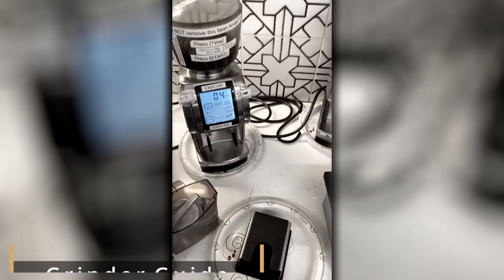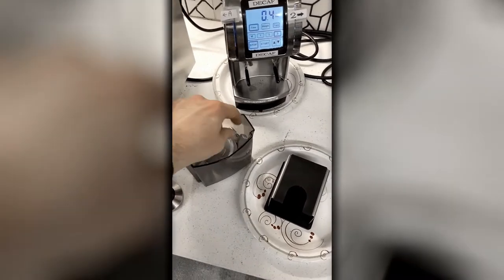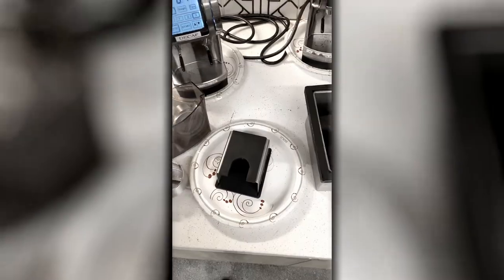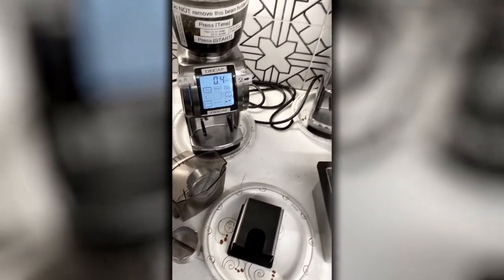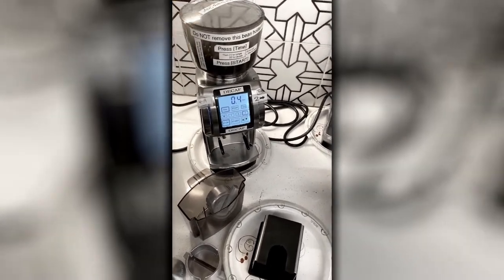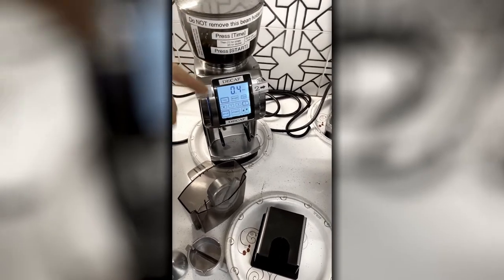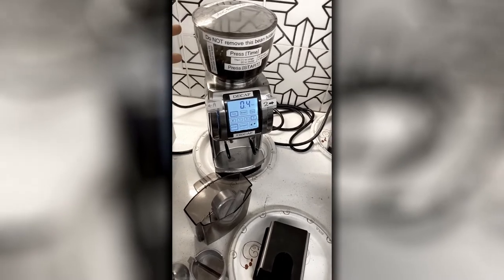I'm going to talk to you a little bit about the grinders. There's another one of these containers in the coffee storeroom, and it has two tools that you may need to use in an emergency. If someone were to really screw up the grinder and put in really bad beans, first of all, as I mentioned before, take some of the rice, maybe 100 to 200 milliliters of rice, and try to grind the rice through the grinder. The rice will absorb some of the oils and may help you scour it out.